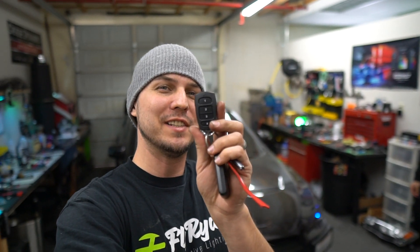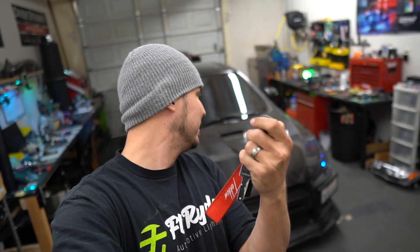All I did was hook up the right and left outputs from the strobe controller and set up that little remote control. Now my man can get his car back — he hasn't had it for like two years. Simple operation: push one to turn on the strobes, push two to change the strobe mode, and push three to turn on the demon eyes. As soon as you turn on the demon eyes they turn blue — that's the setting saved in George's app, so it's continuously customizable and he can change it all with the remote instead of using his phone every time.